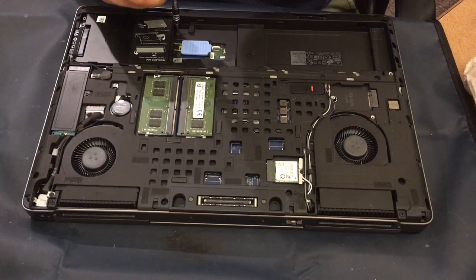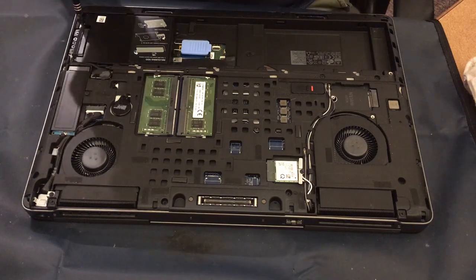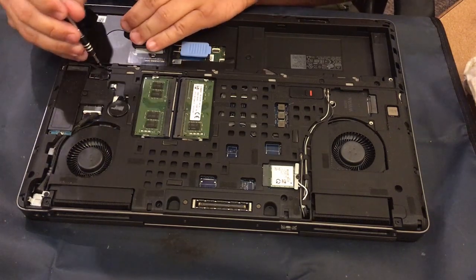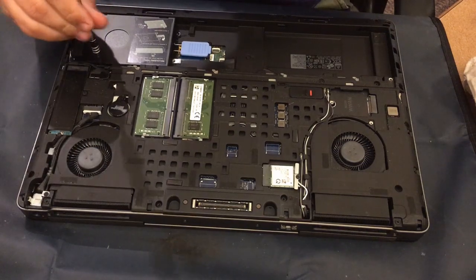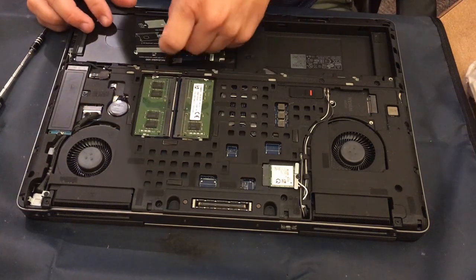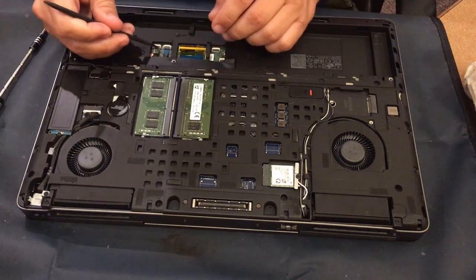As you can see, I'm starting to take some of the screws out. I already have the back plates off — the upper plate you don't necessarily need to take off, I just have it out of the way because I'm going to be checking some other things later on. Four screws takes out the standard style hard drive, and just below that to the left is the slot for the M.2 style SSDs.